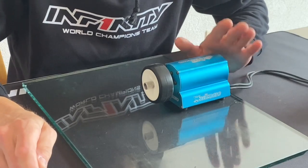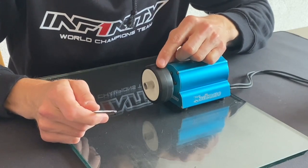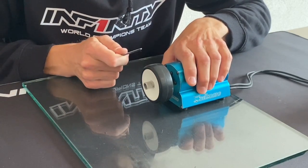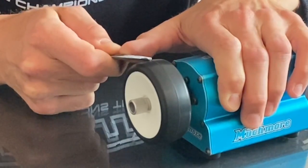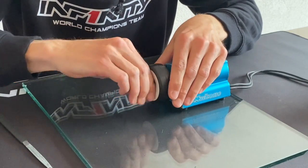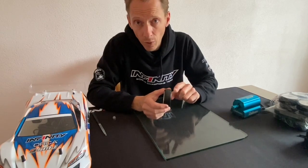The second reason to use the tire sander is to perfectly finish taking off the middle line. I do this with a file — I let the tire spin and gently push the file towards the middle line. Now the tire is ready. The middle line is cut off properly and this will really help your first laps on the track with fresh tires.